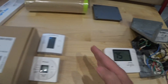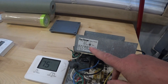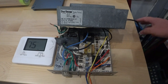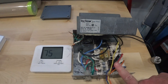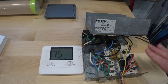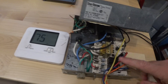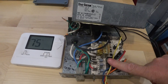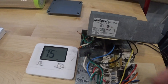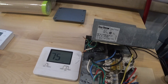Just to get the air working, I reinstalled my old controller that came with the old units that came with the motorhome. So with this little analog controller and this thermostat, what I get is the unit works — my air conditioner works, it comes on and runs like it's normal. That's the rear unit. There's something wrong with this board because it'll cut the compressor on and off but not the fan blower. It was doing the exact same thing when it was installed on the back unit. But I have this same setup on my rear air and it works flawlessly for air conditioning.